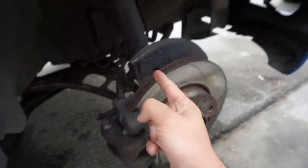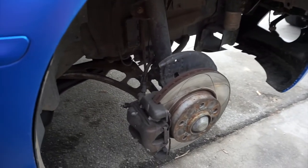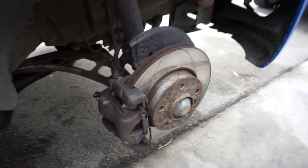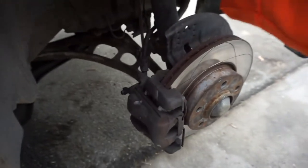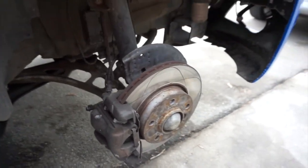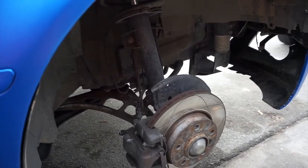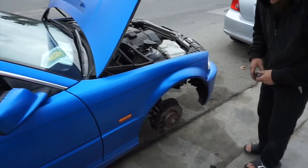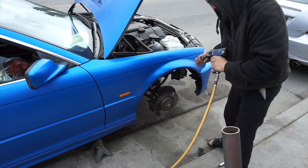Jack up the car, take the wheel off, then basically open the bolt right here, and then three bolts on the top — one, two, three — and the coilover will basically be free from the car. I'm gonna be changing my control arms out as well. These are here — that's what I'm changing — and these ones in the back, and they came with the ECS Tuning suspension. I'm not sponsored by them.